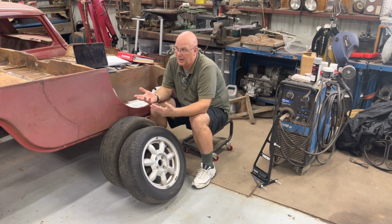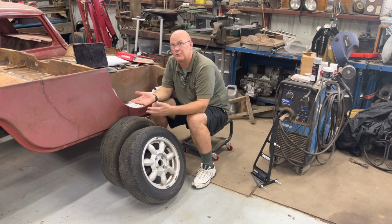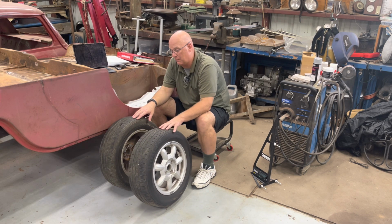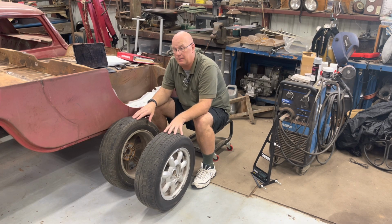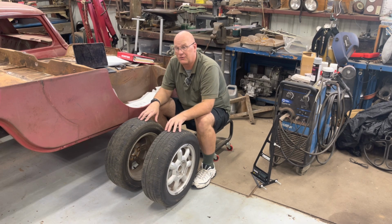Like I said, in the Miata, my weight makes a difference. So I try to do alignments with me in it. I do measurements with me in it. That's up to how you want to do it. If you ride with somebody all the time, having both of you in the vehicle when you do an alignment might be a very good idea, or your equivalent weight, because then the car is going to handle perfectly and be set up perfectly for tire wear for your normal load.